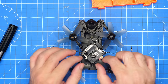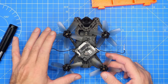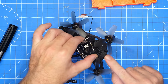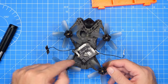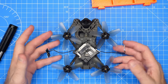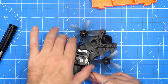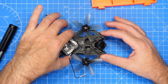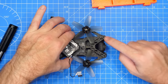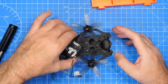This reveals the main base of the aircraft. Removing my SD card, you can then see the main brain of the unit here in the middle. You've got your power connector going through into the main brain area, and then your four motors coming out either side. You've also got that vibration isolation area up front for the front camera — mounted on three isolators — and then the GPS module at the top with wiring going down the middle.